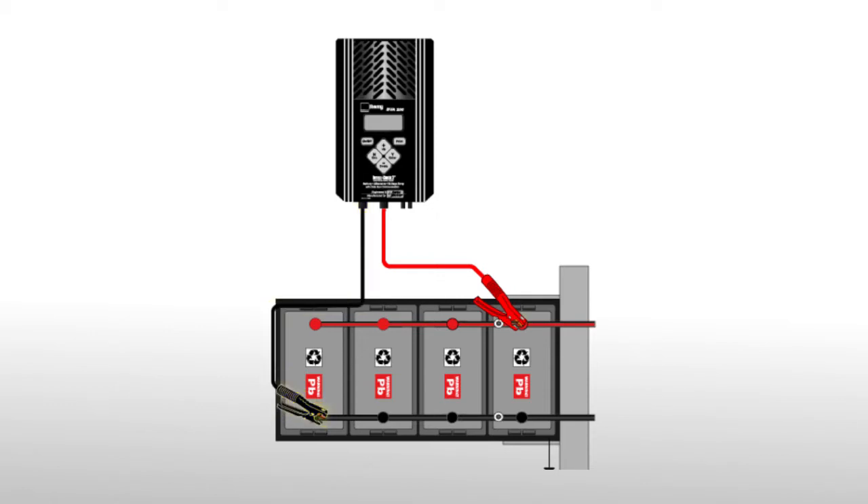When the meter turns on, the load current will flow up the red through the tester, through all those resistor ribbons at the top of the meter, back to ground — full circle. Always remember when you have electrical flow in a circle, wherever current comes from, that's where it has to go back. So by the way we hooked it up, we're pulling current out of all four of these batteries and measuring what that voltage dropped to during that test.